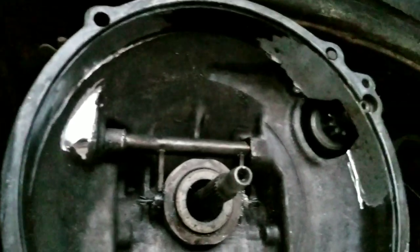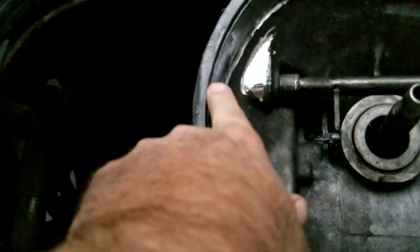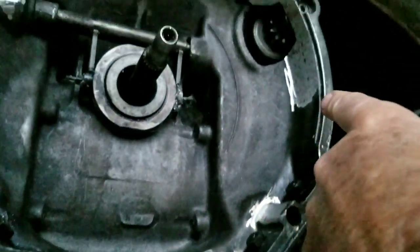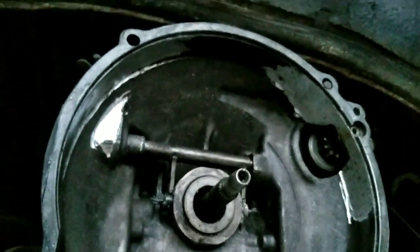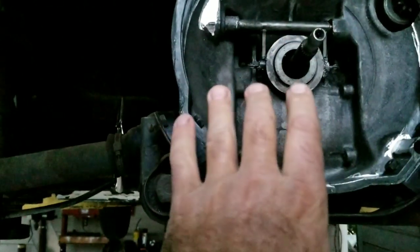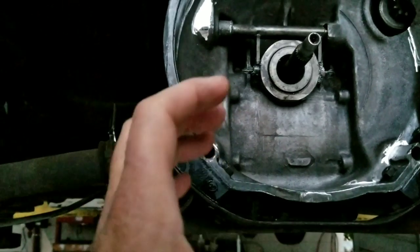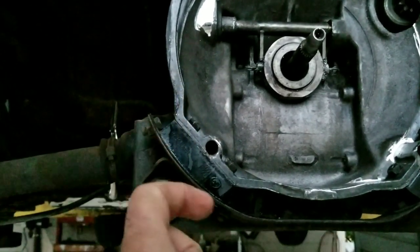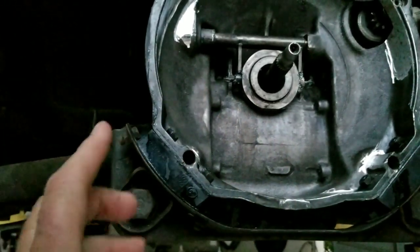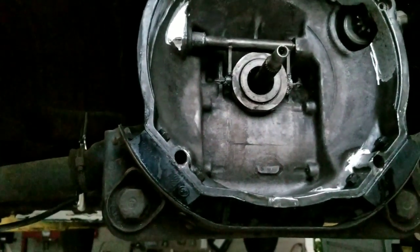Kind of what it looks like — it's about like this here. You can see where you still have this edge. That little edge is still there. You machined this down a little bit, and around here and around here. That should pretty much do it. Sometimes what you'll do is actually put the engine in the car, tighten everything up, and then the engine won't turn. What I've done is loosen up all the bolts on the engine, start the engine up, and then slowly tighten them while it's running. That's one way to do it.